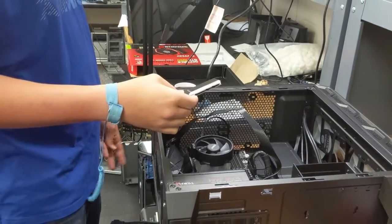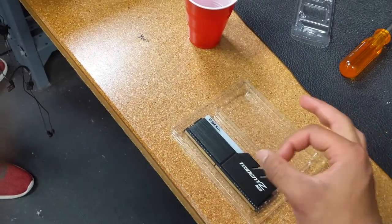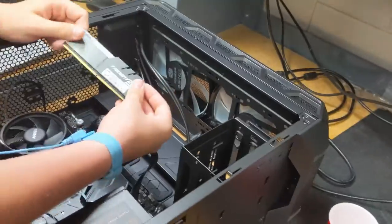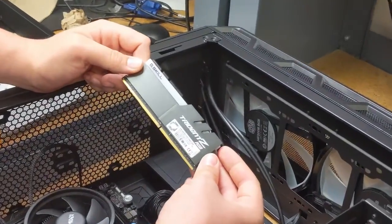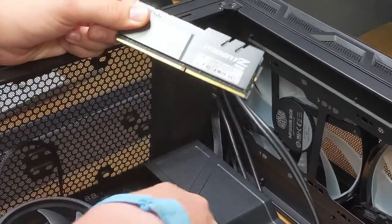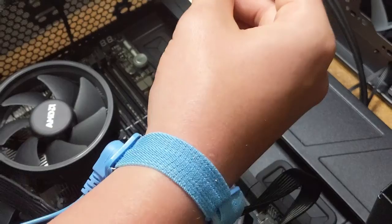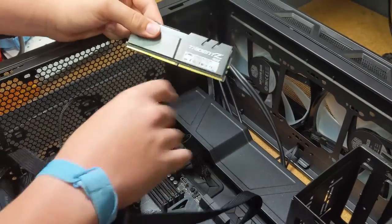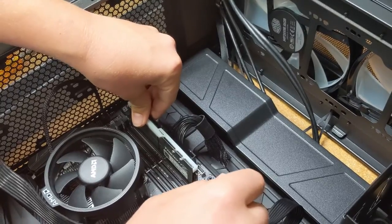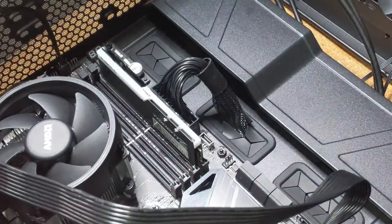Make sure you're grounded for this. Please refer to the motherboard manual or writing on the motherboard to see where you should install your RAM sticks depending on whether you want single channel, dual channel, or triple channel. When installing the memory, make sure the little notch is in the right spot — there's a little metal bar that prevents wrong or backwards memory from installing. The memory is now in.